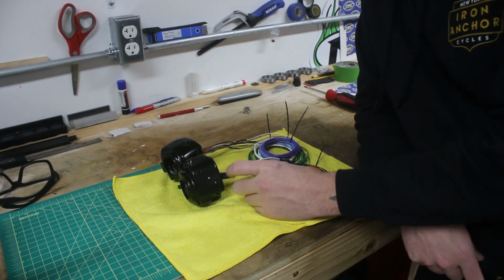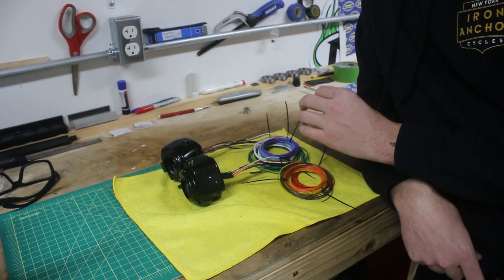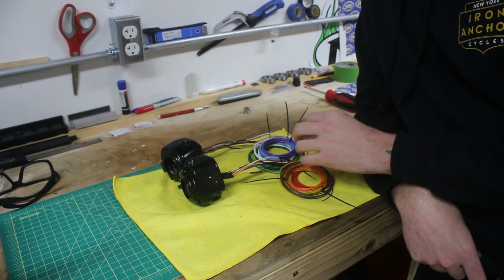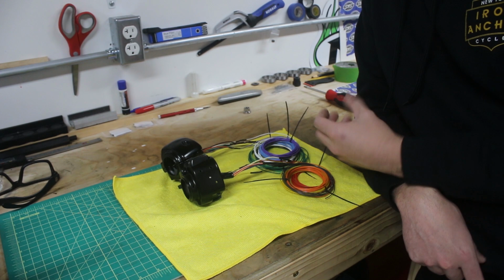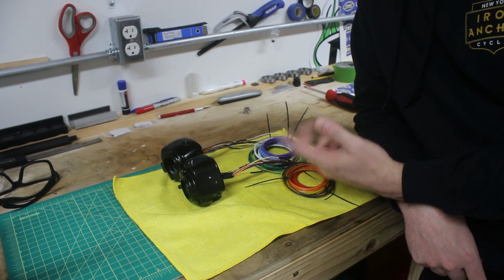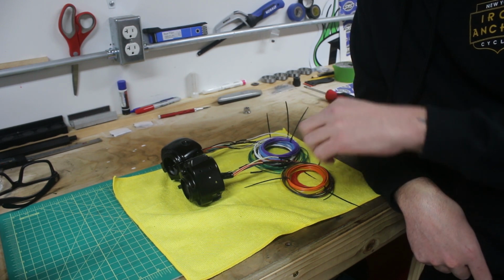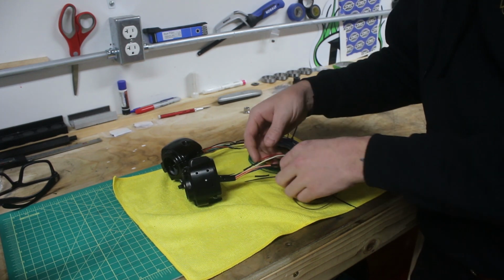The other benefit to making the connections up at the top is because the M-Unit runs extremely low currents through these wires to the switch housings because they're not carrying any load, you can run this incredibly thin gauge wire, which makes it just way easier to run it through the bars and then route your harness down where you need it to go. So this is pretty straightforward.